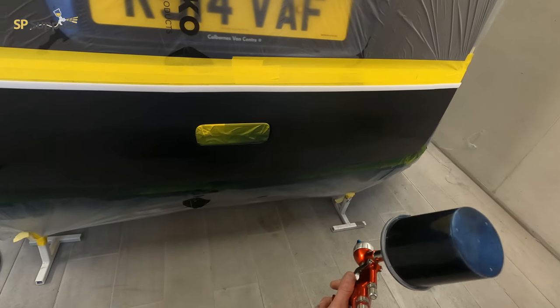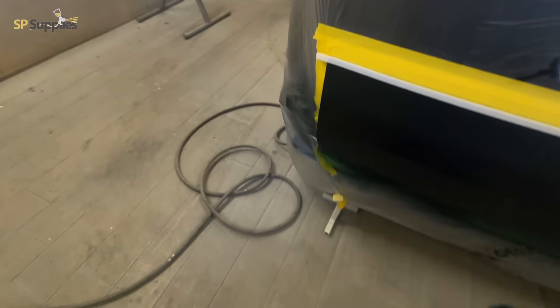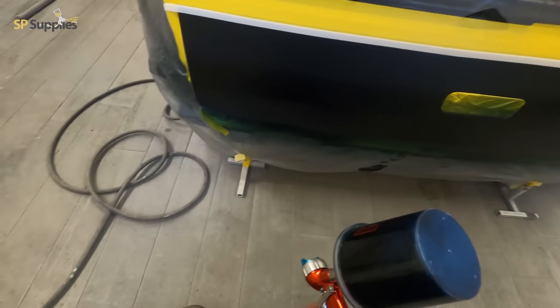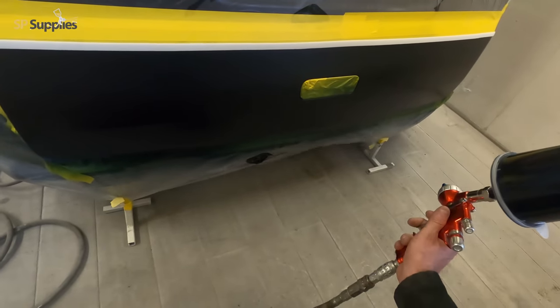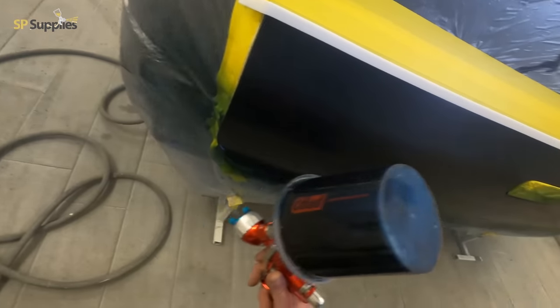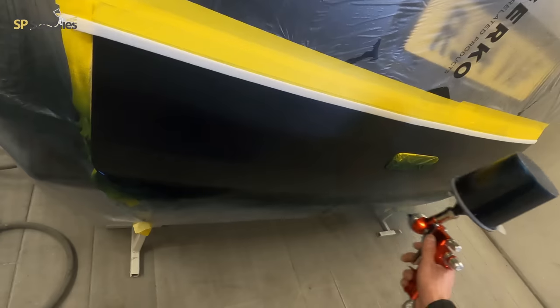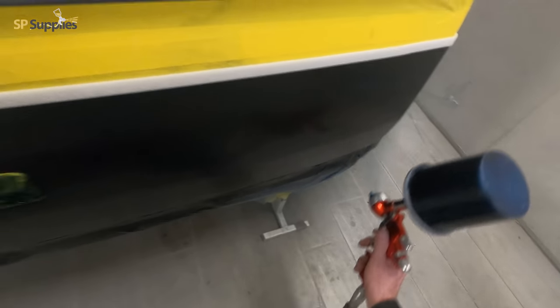For the first coat I've given the actual repairs a slightly heavier coat, then just a light blend across the rest of the bottom of the door to ease that fade out in. We're going to repeat that until we've got full coverage and a nice blend along that middle section. You want to keep the paint edge around about the top of that door handle — not going above that — leaving distance for the clear blend along the top and keeping base coat well away from that tape.